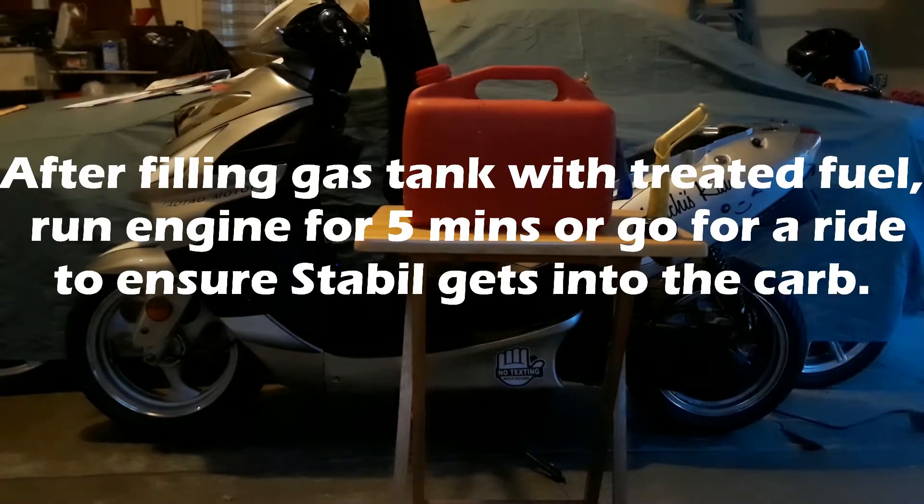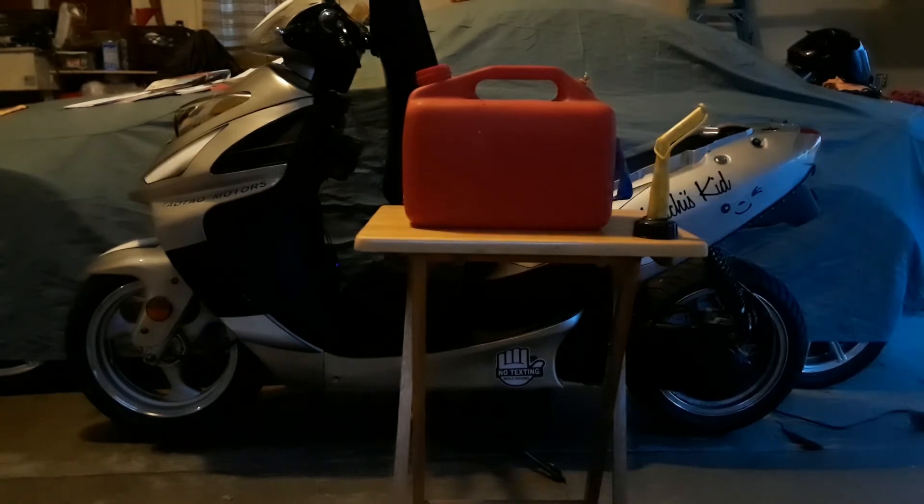You want to fill up your gas tank at the highest level with fuel. This will help with no water getting in the gas tank and no air. As we all know, condensation causes rusting. The reason I put it in the gas can is because if I'm able to sneak out for a ride during the winter, the combination of the Sta-Bil and the gasoline is already mixed, so I can just fill the tank right back up.